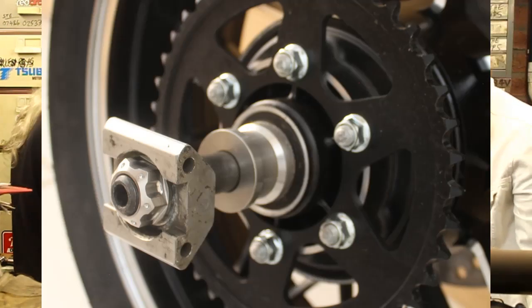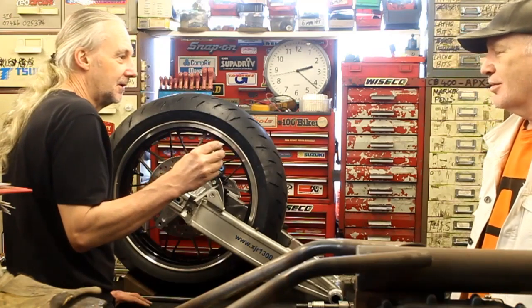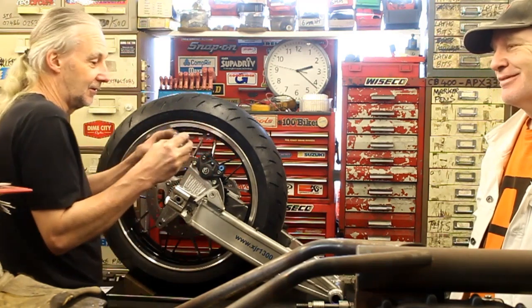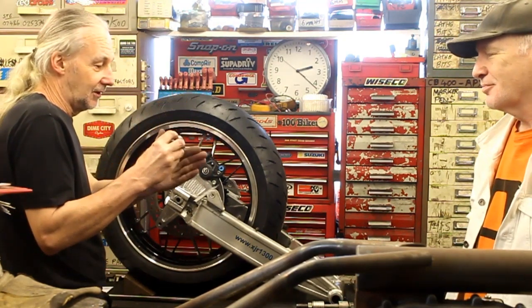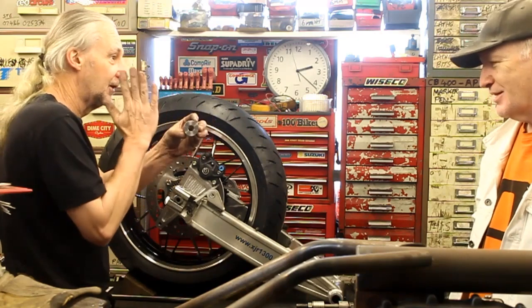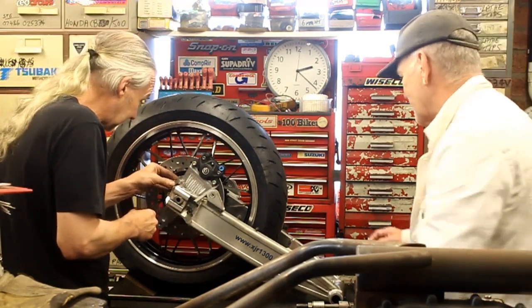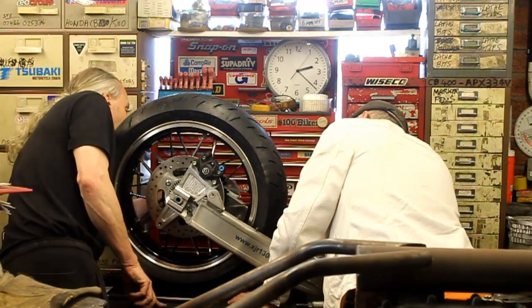People might be saying, that was on the billet, why didn't you hollow it out whilst it was sat on the billet? I did think of that, and then I suddenly thought, if I go in and hollow it out, when you cut it off you've got to be dead right first time, because once it's hollowed out and it's off, it's then awkward to hold. Yes, to face it. Absolutely, to hold it.